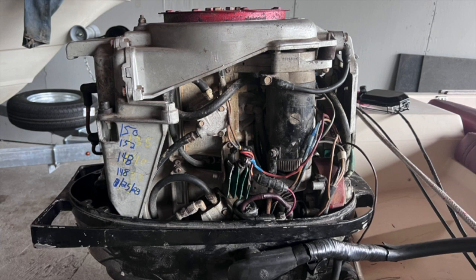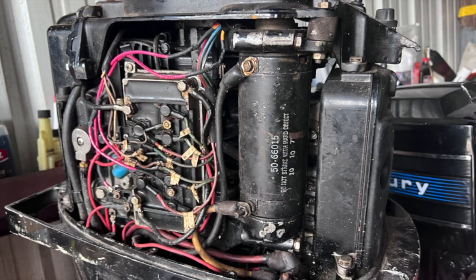Some say they can turn the flywheel and tell if the cylinder's compression is within 10%. I like using a gauge, but keep in mind that every gauge you use can be different. Spark can be from the distributor or power pack. There are many simple tests for spark, or you can use the process of elimination — spray some carb cleaner while cranking the engine. If it shows signs of life, then it's likely fuel, but I'd like to confirm it with a spark tester and even hear the sound of the wire arcing.